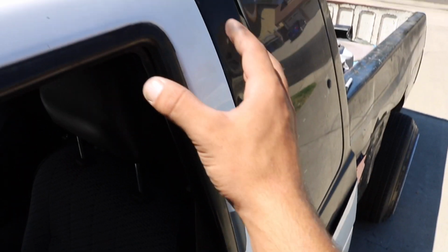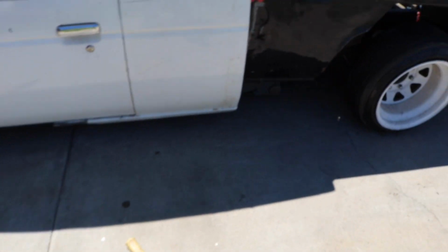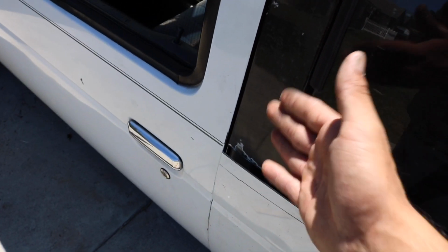But what I'm thinking is the truck got hit so hard right here that this whole B pillar probably got crushed in a little bit. Obviously you can't see it with the naked eye, but I'm sure if you put this on some lasers and stuff, it would show that this is all bent in a little, even though you can't see it. That's what I'm thinking is going on, because it got hit pretty hard, to where you can see all the sheet metal's all crumpled up. Not too hard with the frame damage, but just enough damage to mess up all this sheet metal here. So I might just have to accept this gap. I'm obviously going to do my best to get rid of this gap, but you can't really make it 100% when it's already been kind of deformed.